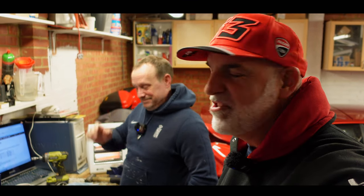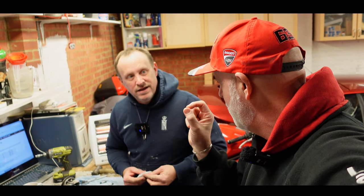Welcome back to Nelly's Garage. We're finally resuming our engine build. So the last video we got up to a point and we did a little bit of rework, because some of the clearances were slightly wrong. I misread the manual - the clearances for the gear shafts, the clutch shaft and the output shaft. I read the clearance for the shift drum which is 0.1 to 0.4 when really it should be 0.05 to 0.2, so they've now been adjusted.